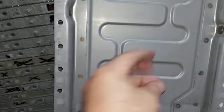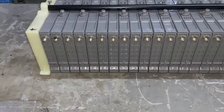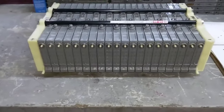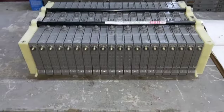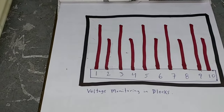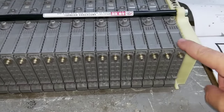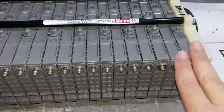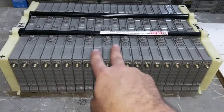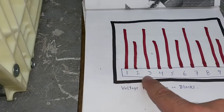You may be familiar with the P0A80 code — 'replace hybrid battery pack' — which triggers the warning light on the dashboard. When monitoring with the Dr. Prius application, you'll often see a V-shaped pattern, which means the weakest cells are in the middle. Cells numbered one and ten at the sides are the highest, and progressively from the middle outward they're losing capacity. The answer to why this is a common pattern is simple: heat.